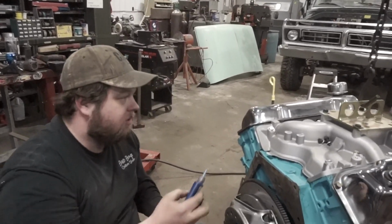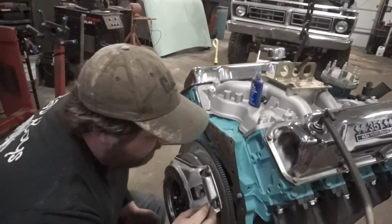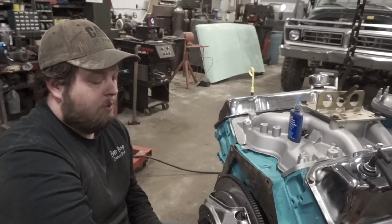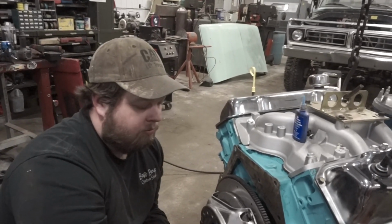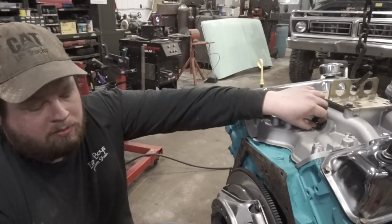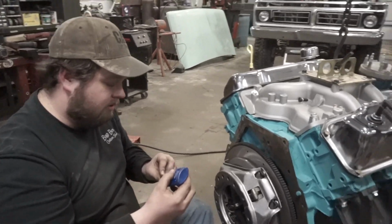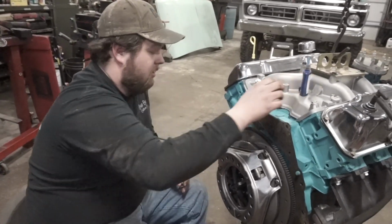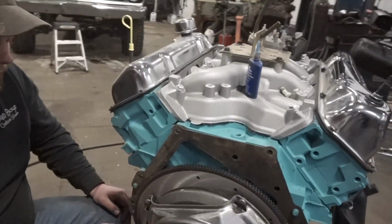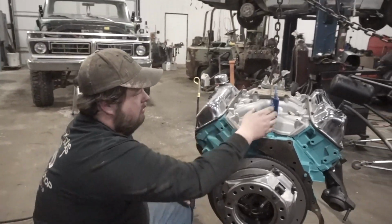Well, this is medium strength. It's not your red. With the red, probably 90% of the time you have to heat it up to get them to break loose. This is just, you know, a 3/8 impact is going to take these out. Also a nice little 3/8 breaker bar would probably take these out too, if you even have one. I do, because he runs a business.